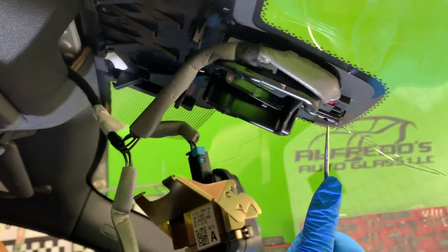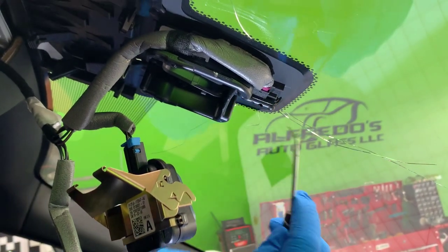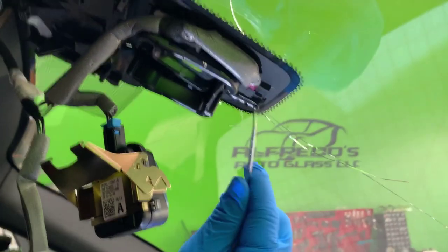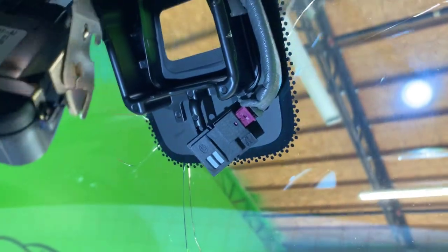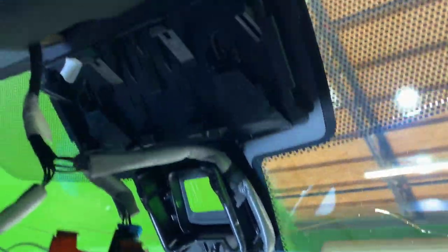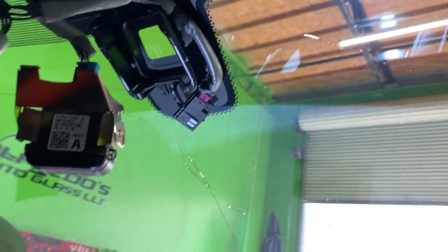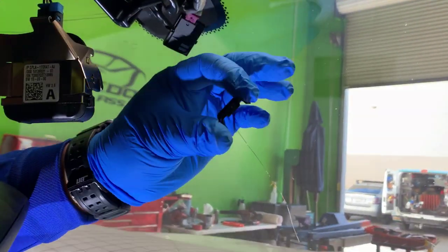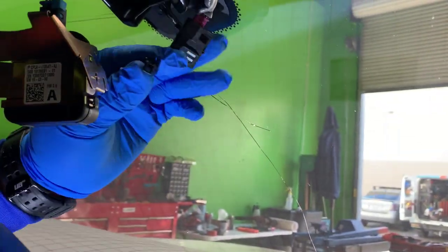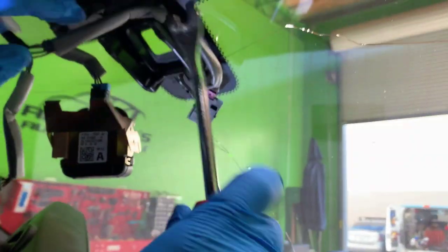If you're trying to pre-scan this, it's giving you no connections because it has no ADAS system. This little bracket — there's one little bracket there, so you could push just gently. You do not want to lose this little piece — let me grab it. This is the piece you do not want to lose because this locks your condensation sensor in place. Keep that aside.